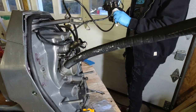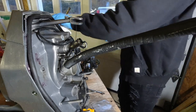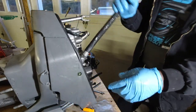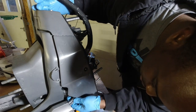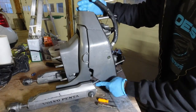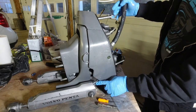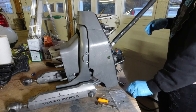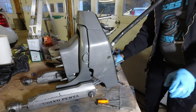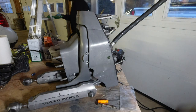So this is how you properly swap out these hoses. If you have these hoses, they normally run forever, because they don't normally get exposed to the elements like the ones on the hydraulic ram. If you look at these right here, I've got a little bit of weather cracking, kind of stress cracks, so I need to change out these ones for the hydraulic ram. They come with four hoses in total, two on each side, and they're like $300, which is pretty expensive. Everything that says the word marine is super expensive. This hose was pretty expensive too. Let me get the part number real quick.